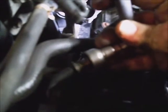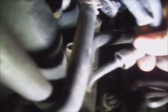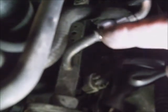And just walk it on. Wiggle a little bit. Keep pushing till you hear the click, and maybe a little past. And pull on it slightly. Wiggle it. Make sure it doesn't come back off. There should be less than 1/8 of an inch between this second ring and the opening of that bell. Make sure it stays on there.